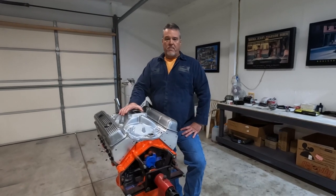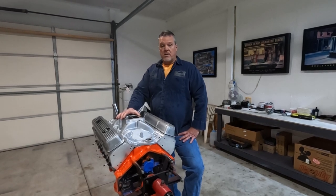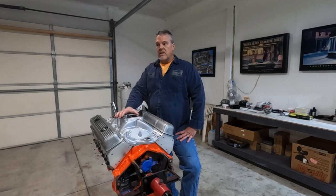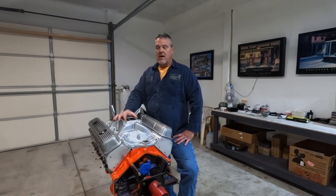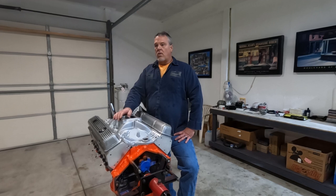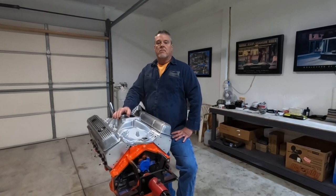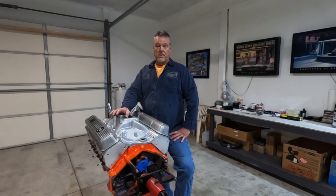It was really important for me to share this video with you guys, because when I was trying to figure out this problem or issue, like I said, there was some information on forums and stuff like that when I started doing some searching, but nobody ever gave an end result of what happened. Or there was one guy who said he had to readjust his rocker arms. He had them too tight and the valves weren't shutting. If that's the case, I 100% believe that.